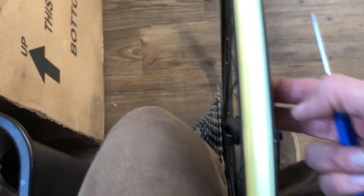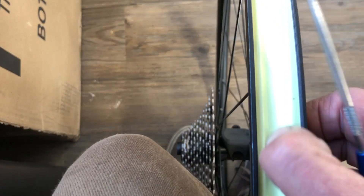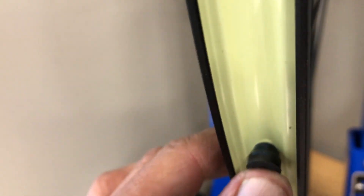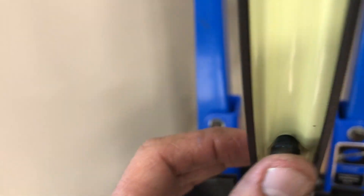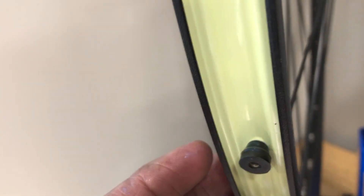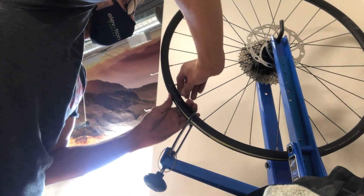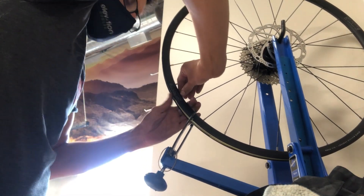I'm trying to locate my valve hole, and I just take a little pick or awl — something sharp — and just poke a hole through the tape. Some guys just poke the valve straight through, but you want to be super careful not to tear it. I've got a little film of sealant around the sides of the valve and on the rubber part — I feel like that helps it go in just a little easier and maybe gives it a little pre-seal. Push really hard on the back side of the valve as you're turning that nut, and that'll really get it seated in there.